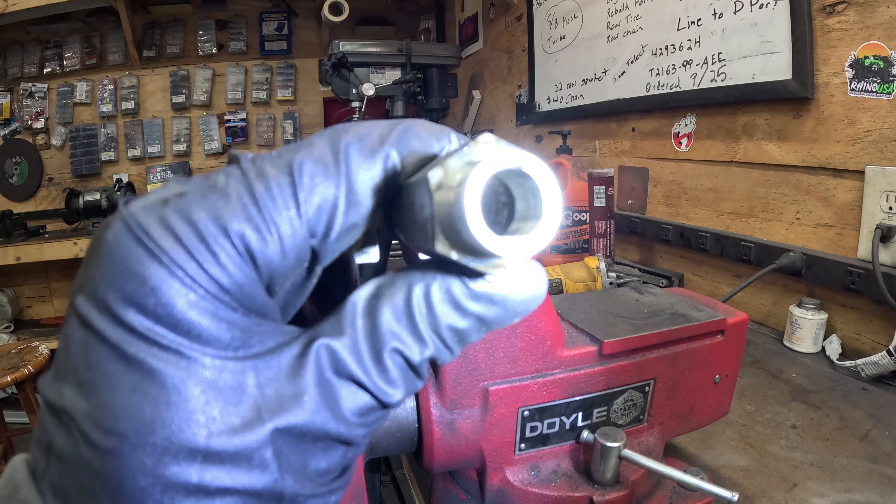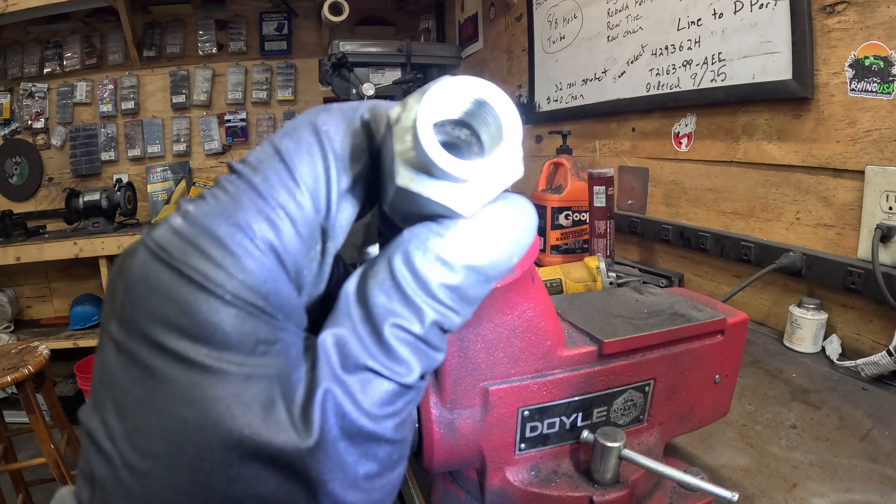Go ahead and get your hose mounted back in the vise. Now pick up your reusable fittings — I've got these 3/8 fittings here for this demonstration. These are new fittings, but I have lots of used fittings that are still good. When you get your fittings they'll come assembled, so we'll have to take them apart to actually make the hose.